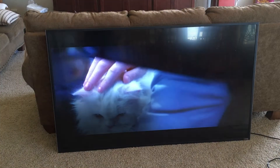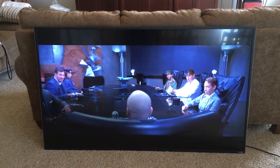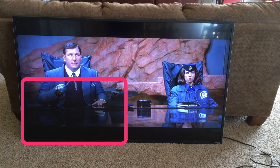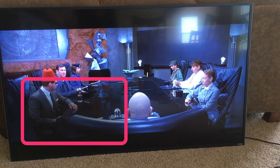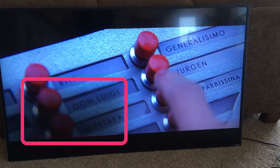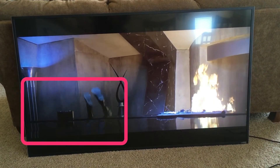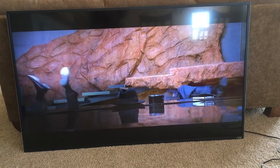Take it from me, I learned the hard way and stripped the entire TV down to its LED backlights and realized that wasn't the issue. Here's what to look for. If it appears that an entire quadrant of your TV is out — meaning one-fourth of the TV — in my case the entire lower-left quadrant had no working LED backlights. It's a whole section, and the outage is uniform. If one or two LEDs are burned out, the dimming will look sporadic and uneven. Even if an entire LED strip goes out, that will show up as a single dim line. The uniformity of the quadrant should have tipped me off.